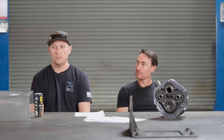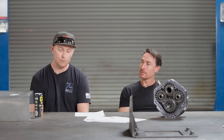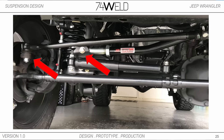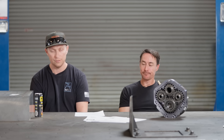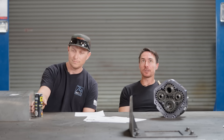What can you do about bump steer? For zero to two-inch lifts it's kind of a 'good enough' situation — there's a reason the Mopar two-inch lift kit keeps it at a low level. For higher lifts on JKs it's super popular to do a drag link flip: you flip the drag link mount on the knuckle from underneath the steering arm to the top side, and add a track bar relocation bracket — essentially putting your drag link and track bar back in phase with one another. Downside is you now have less clearance to the frame and you're limiting your up travel.